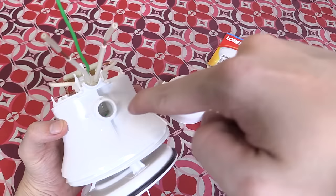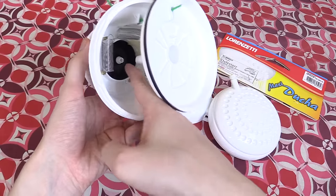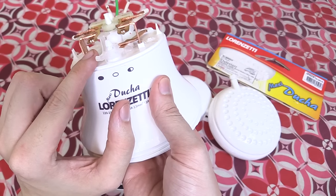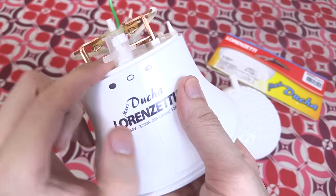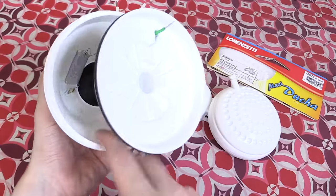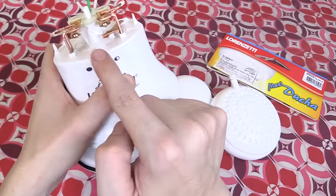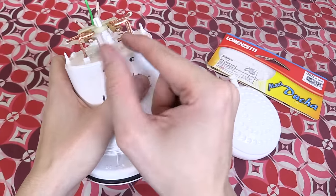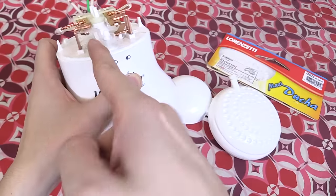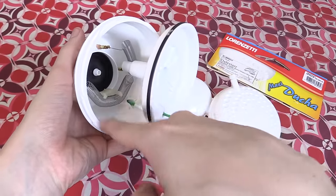So how does it actually work? The water comes in here and fills this cavity, which then pushes on this diaphragm inside. And when that pushes up, look at the contacts — you see how they make contact? That's all that's happening. It will only be powered when there's water inside because it needs water to push this diaphragm and make the switches contact and pass power. When you use this switch to choose full power or half power, all it's doing is putting a piece of plastic between the contacts so the diaphragm can't make contact — therefore you've only got half of the heating element turned on.